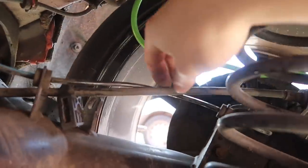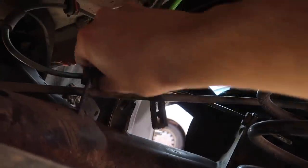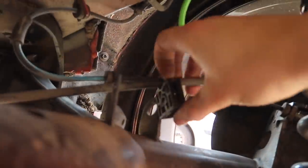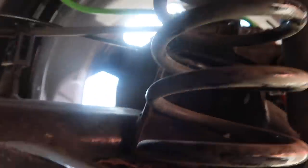I'm in a clean top from Prime Mike, don't want to get it ruined. I've worked out how it goes this side but I think Ryan cocked this up when he fitted it. Ryan's put the ABS sensor on, but if you see here - ABS sensor line is here, it has to go over that because where I thought this goes on here, it goes on there instead. You can't do it one way or the other because either way it's bending over. So I think I need to undo that - it's just like an 8 or 7 mil - and then rewire it through, put the handbrake cable on and this needs to be over the top not behind the back. That was Ryan's fault, not mine - I'm fixing his job.